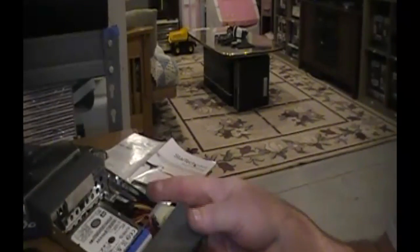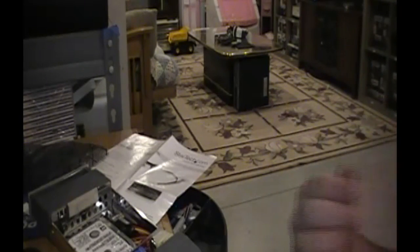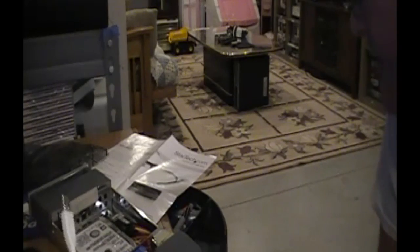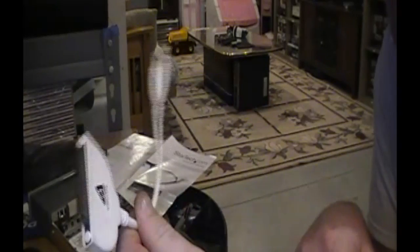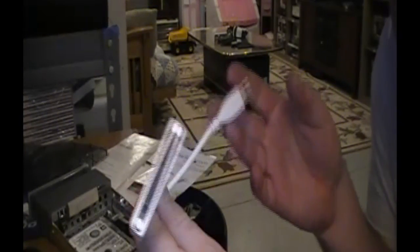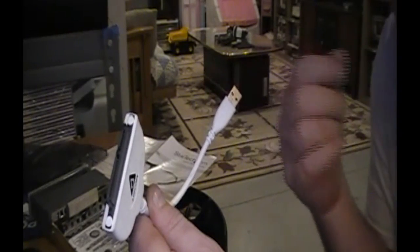On the previous drive I put in, I was getting all these errors about data loss during rebuild. There was nothing on the RAID. I mean, I had some junk on there. I erased it. I was still getting them when I put the drive back in with nothing on the array. So what I ended up doing was I have this USB to SATA adapter, and it's self-powered. Just plug it into a USB port. I mounted it on OS 10 and just erased the drive, did a GUID partition, named it 500G, and stuck it in, and no more errors.